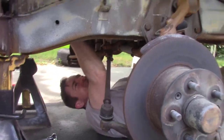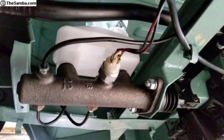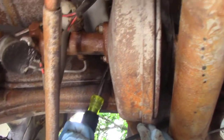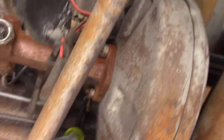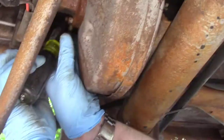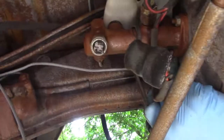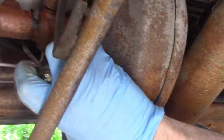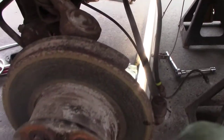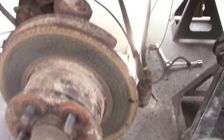My buddy Patrick's helping me out. Then we move to the master cylinder — we disconnect the electrical, the brake lines, as well as the vacuum tubing on the brake booster, and the brake fluid reservoir line on the top. So all that stuff around the master cylinder and brake lines has to be disconnected there.